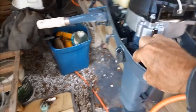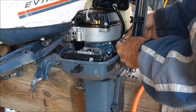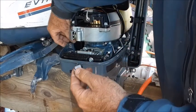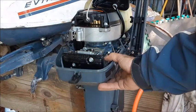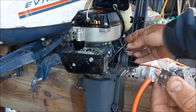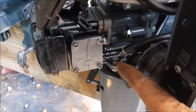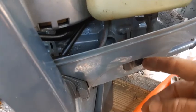By turning the motor around backwards it actually gives you better clearance to be able to get to the two bolts up underneath here. There are a couple of clips right here on the side that have to be lifted up and removed — there's one on both sides. With these two clips off, this front piece can actually just pull right out of the way and you can get access to the carburetor. You'll also notice the two clips are actually a little bit different — the one with the rubber tab on it came on the right side of the motor, right next to the tiller arm. You can take this gas line off. Make sure you turn the gas off on the side here — the thing pushed all the way in is the off position.